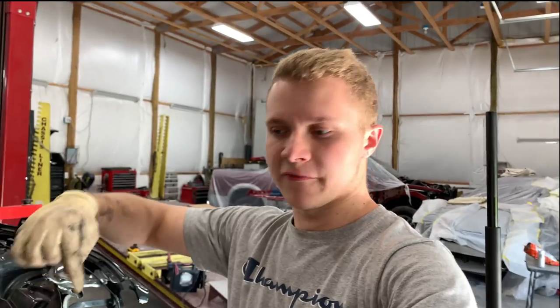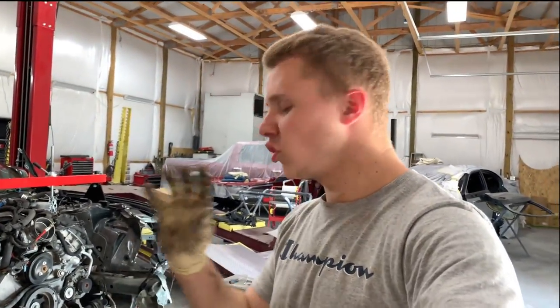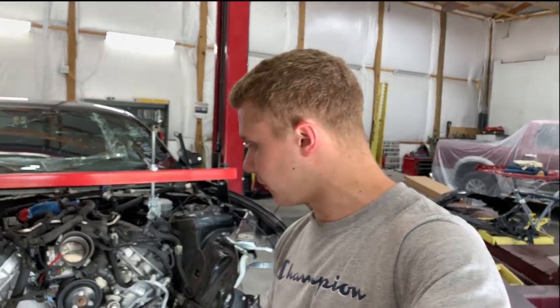And the transmission mount, I'll show you that in a sec. I took it all off because it's all broken into pieces. I found a heavy duty strap for hauling, for trailer stuff, and I cut it in half, put some holes in it, and then used it to hold the transmission because I couldn't find any chains short enough to hold it. So the next thing I want to do is drop the subframe,